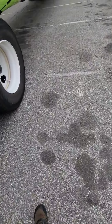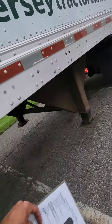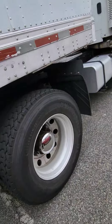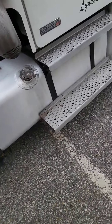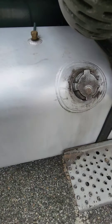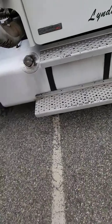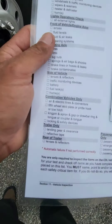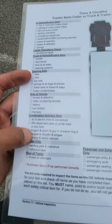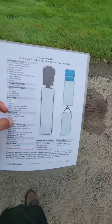Let's go to the other side of the truck — we have one major part: the fuel tank. Don't forget it. The DOT tape on this side is good. Four-way flasher is working properly, properly illuminated, proper color amber. The fuel tank: good condition, not cracked or broken, nothing leaking, secured with the metal straps and rubber backing. The fuel cap — check the rubber seal inside and make sure the chain is also present. That is it. You can check off all external lights and the fuel tank, which would complete your Class A checklist on the automatic truck.